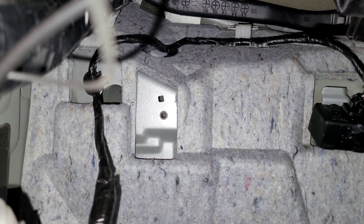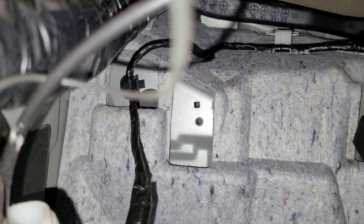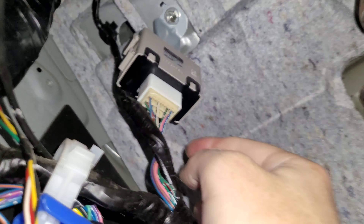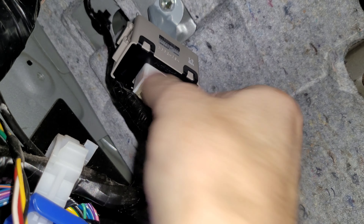Underneath the dashboard, look back here — that's your firewall. Then look up, and there you have the little place where you're supposed to attach the wire module. Use the included screw; it will require a 10mm socket. Find the little wire that goes into that — it's going to be down here. You can see the back side of that wire right there, right behind this cluster. There's a little piece of tape that holds it; we'll cut that tape and plug it in. That's all connected in here — it's a nice joint. We've got it tucked behind this major wire grouping here, nice and tight. Make sure it snaps when you do that.